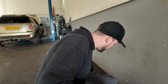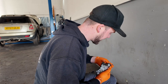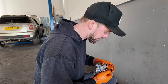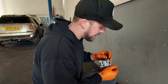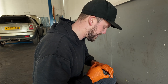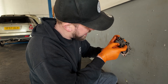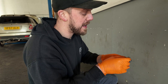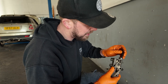So — oil pump. There was a part of the oil pump disassembly that I didn't show, which was this: how to assemble the oil pump. There's a spring and a plunger — plunger goes in the spring, that goes on there, that fits in there. Then you push it all in and secure it with a split pin. It's a very simple design — you have these two pushing against each other, and eventually when there's enough pressure, it bypasses and oil is allowed to squirt out the end of the oil pump. It couldn't be any simpler — the oil pressure relief valve on this is completely mechanical.